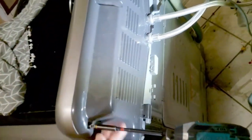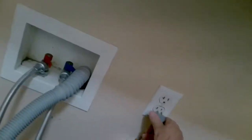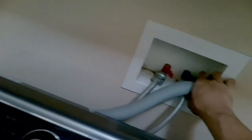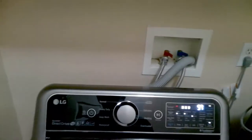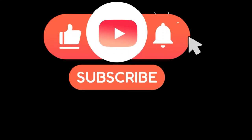Just reinstall your screws — in this case we only have three of them, but it should be five: three at the top, two at the bottom. Another tip on this drain line: make sure you press it in there. I would recommend zip-tying the drain line to the water hose so that it will not kick out on you. If you have any questions, please leave a comment below. I hope this video was helpful — please like and subscribe for more future tips and videos. Have a good one.